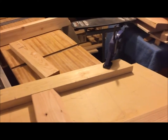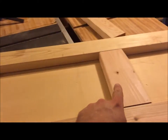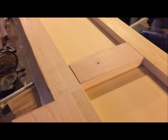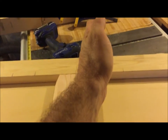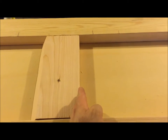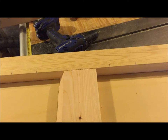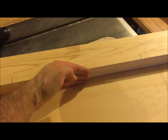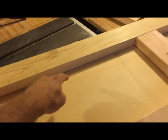One last update before screwing and gluing: I took a couple pieces of scrap cut off from this section and made two extra pieces for structural support. When I install this in the boat, I'll have the gusset coming off here down to the bottom stringers, and it'll also be screwed down to the stringers. This whole side will be sealed in the hull of the boat, same thing with the other side.